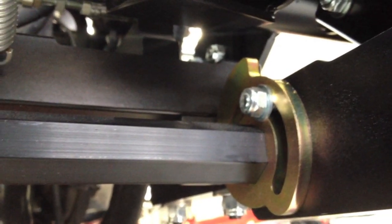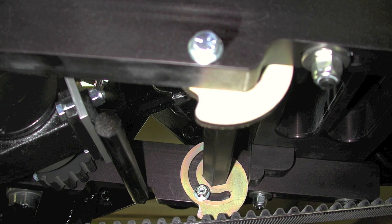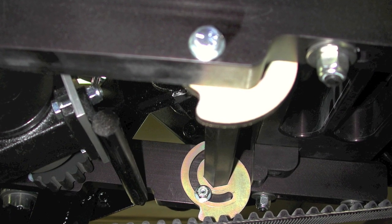We mentioned the term adjustable on the belt drive kit because the belt is easily adjusted by controlling the length of the swing arm with a rotating hex bar and cam. The advantage of this system is that the belt stays in alignment at all times. Roadsmith innovated this type of foolproof system on their belt drive kits.